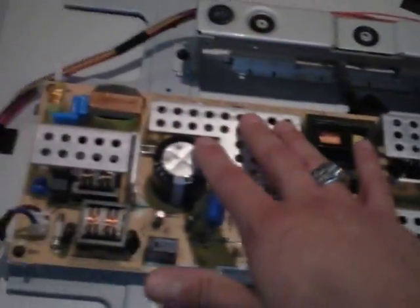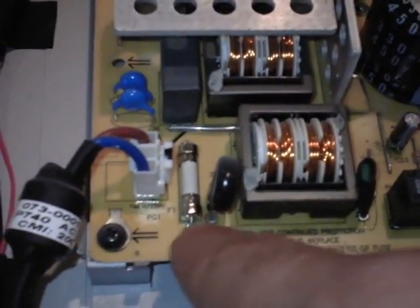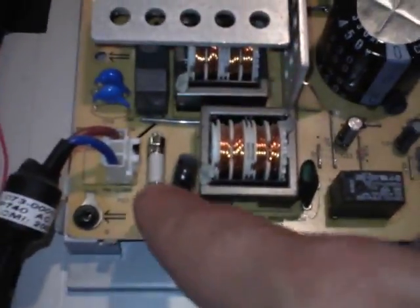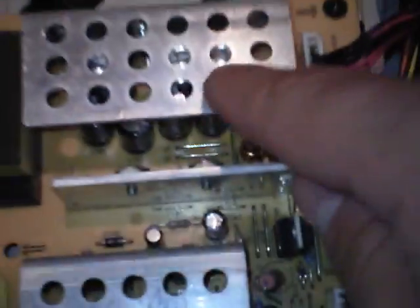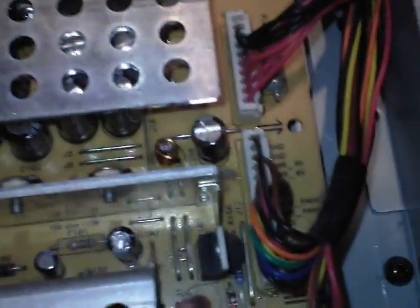So this is the power supply. Sometimes these capacitors under this heat sink go bad — they pop and they bulge and there's a bubble on top of the capacitor. These actually look good. There's a resistor; sometimes the resistors get a little burnt looking and they might be bad. Check the real fuse — if the fuse is bad, of course replace it. That's in case you had a power spike. Most of the time it's the capacitors that cause the power supply to go bad. You just change out the capacitors under here — you have to take out the heat sink using a hot solder gun, like a 60-watt. If you're using under a 60-watt solder gun, good luck — it's not going to work very well.